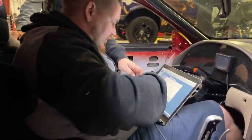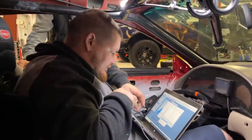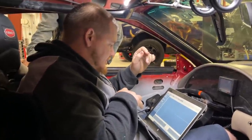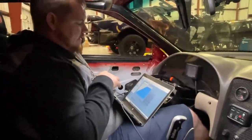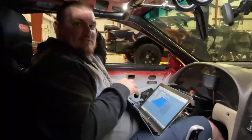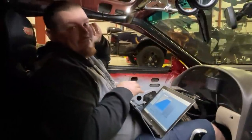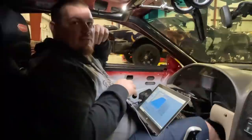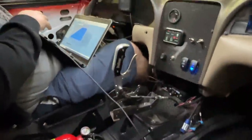I was commanding 5 on the dome — before going down track we were at 13. Dude, that's all we need in this car. If we can leave the line, we're money. I just want this thing to run 8.50s all day. What do you think we do here? I'm gonna put it back where it was and we'll just do another little rip, make sure everything's dialed. I was commanding 13 on the dome before — that last one was only 5 on the dome, so it made 10.7 pounds. You're gonna put it back on 13 for when it hits the track tomorrow? Yeah, we'll put it back. Let's see where the transmission temps are at.